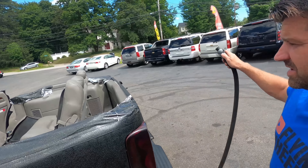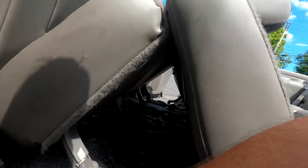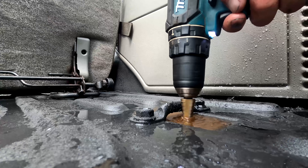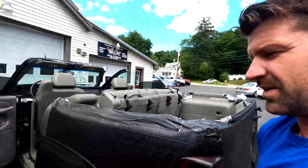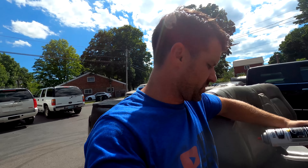We've been fortunate with a heatwave and no rain. Today is the water test — we're going to figure out where the water is puddling and then tap some holes so it drains. I'm just going to soak it since eventually it'll be out in the elements. We already have a couple obvious areas, and the front is draining too. All the spots are dried. Water, moisture, rust — so I'm going to touch up all the spots we drilled with truck bed coating to seal the metal so I don't have to worry about those holes rotting out.